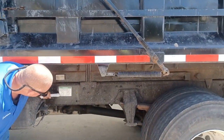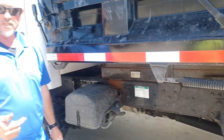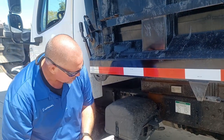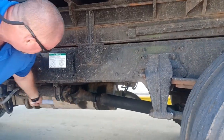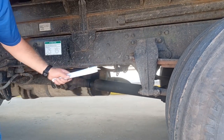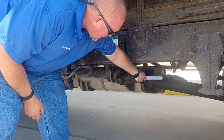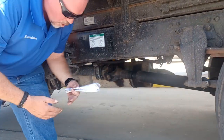We're going to move our way back and look at our frame. Make sure there are no holes or illegal welds, none of the cross members are missing, and everything is bolted to the frame properly. Moving underneath the vehicle, we have a drive shaft — this is part of our drive line. There are two on this truck. Since we don't have a second axle on the back, there won't be a jack shaft between them. We're looking at our U-joints — there's no debris caught up in the U-joints. The drive shafts are not twisted, not cracked, and there are no bends in them.